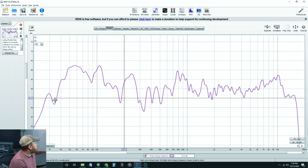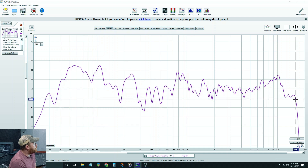You can see the bass from about 40 to 100 Hz is up. There's a trough in the 100 to 700 Hz range. The 700 to 1k area is kind of high, then pretty even through the vocal range. Odd that it comes back up at 10k. And there seems to be a low-pass filter right around 16k — so no information above 16k on the Tesla Model 3. I find that kind of odd, not that I can really hear that anyways.